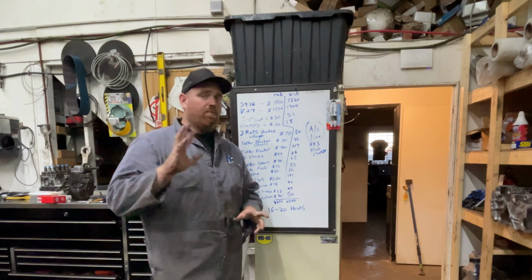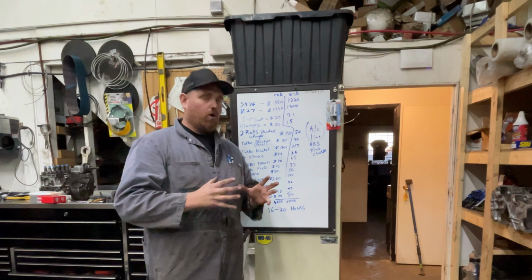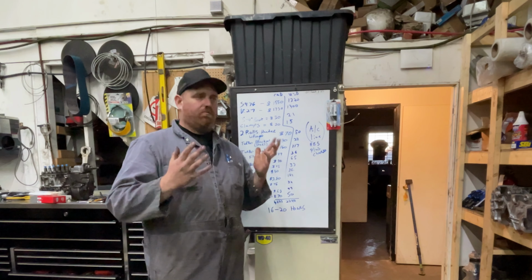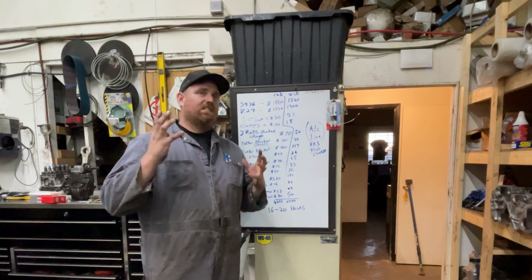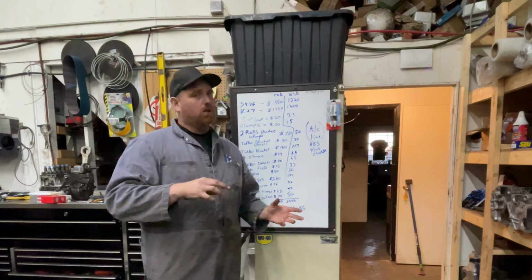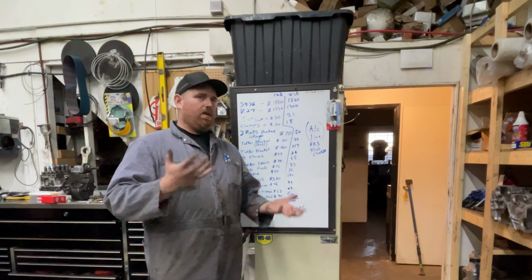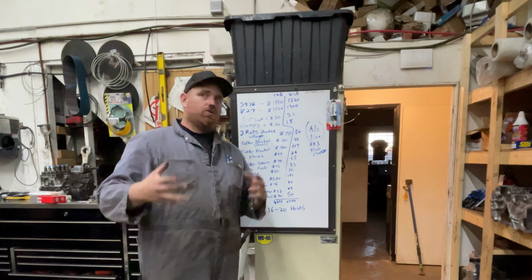It's not a K27, but a different turbocharger that has a bigger exhaust or a bigger turbine wheel in it, or turbine, is how you want to say it, but we call it turbine wheel, to expel the gas a little bit better, but you do lose a little bit on spool, but not bad. But it just depends on what you want.